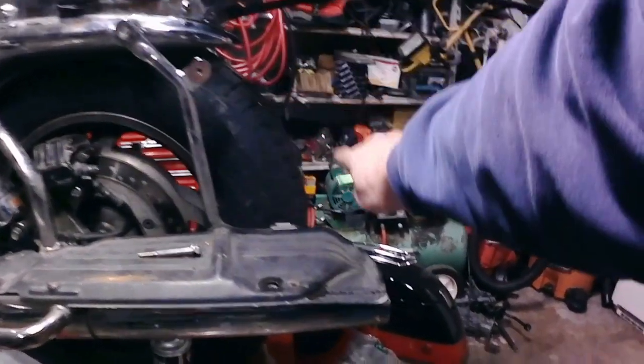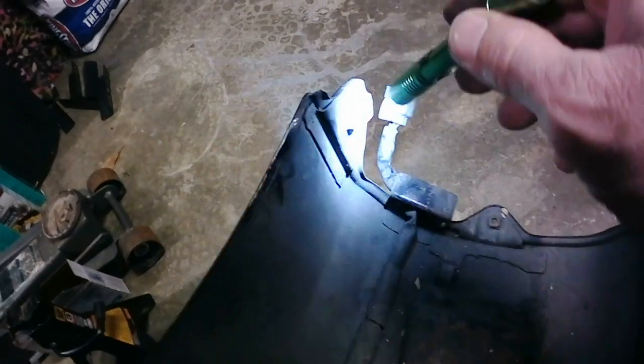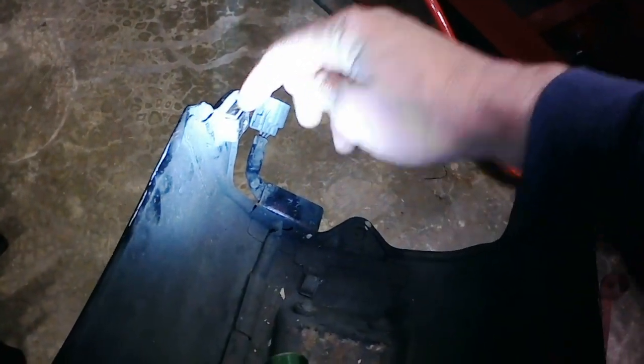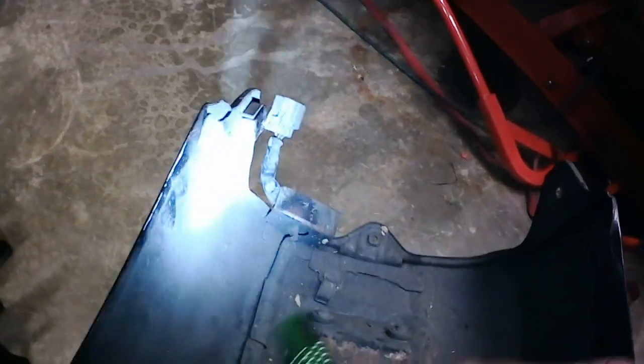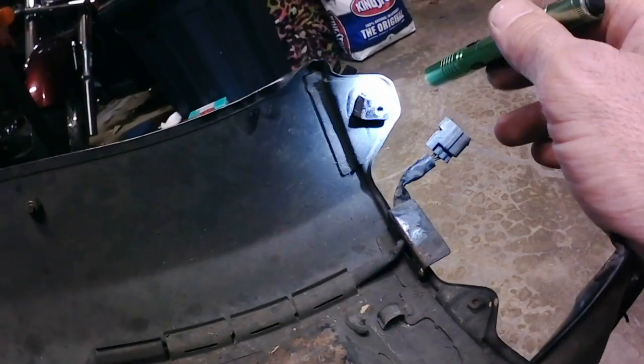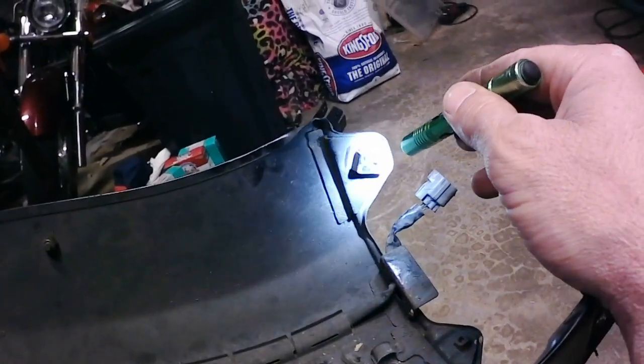But the nut cage modification, this is the lower section of the rear fender. So this attaches up here to the front bolt, and it's what drops down in the back. Now, that is the cage nut and the nut cage. So, just hold the light here. This outer section is what's called the nut cage. The actual nut itself is the cage nut. Okay? The issue you run into with a Darkside tire, you can see how that's shiny on the outside. That's because the tire has actually been rubbing, as the suspension compresses, on the outside of that nut cage.